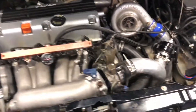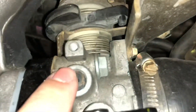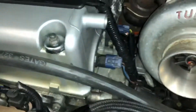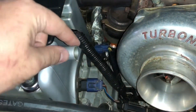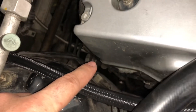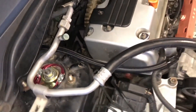A couple of the items I ordered for the car: where the MAP sensor would go on the stock throttle body, they stuck something in there to block it off, so I bought the K-Tuned MAP sensor delete plug. I also got the K-Tuned breather filter because there's an open port here that just blows hot air. And back here where they have another bolt stuck in — turns out that's for the factory oil cooler — so I bought the K-Tuned delete for that.